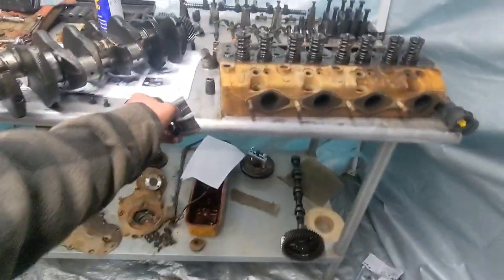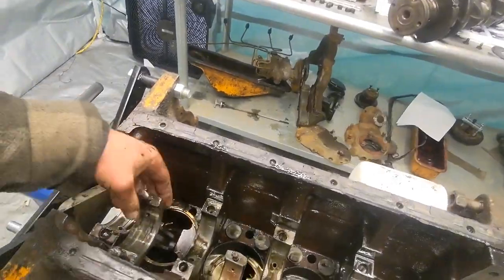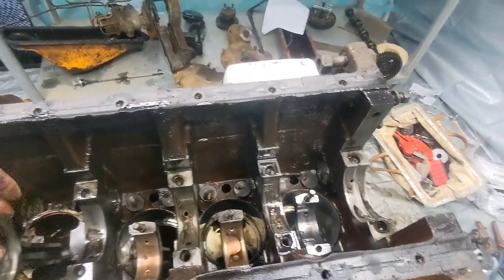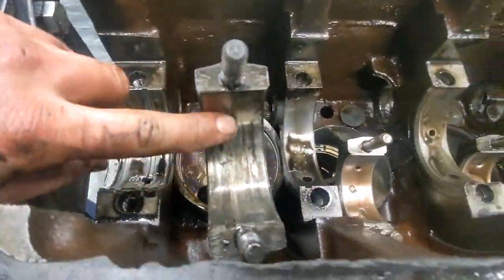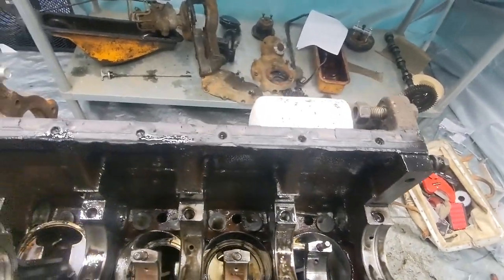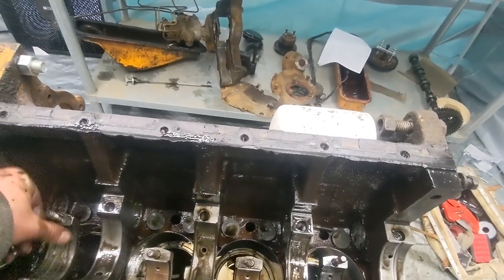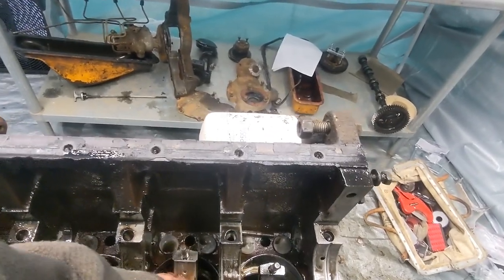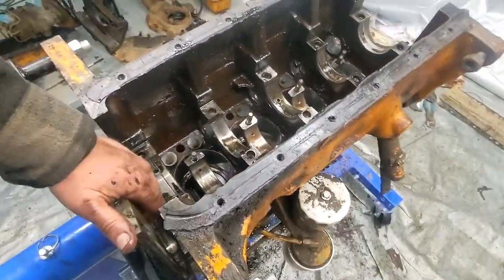I'll get the pistons - pistons have got to come out the top. That's not even the bearing - you can see where it was spinning, so that's trash. We'll get these pistons knocked out of here and see if we can't pop the sleeves out. Now, there's a tool for pulling these sleeves but I don't have one, so I'm going to try and just knock them out from the bottom. You'll see how that's going to work. I may just have to get a sleeve puller - they didn't have one at my local auto parts store.